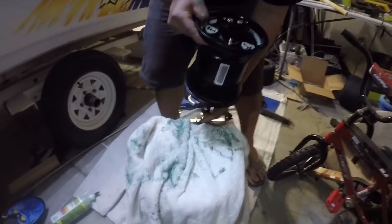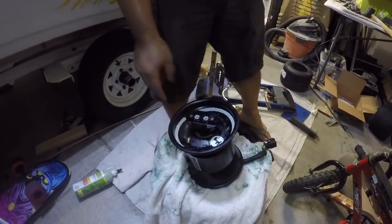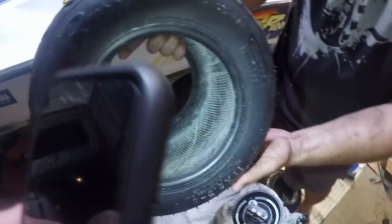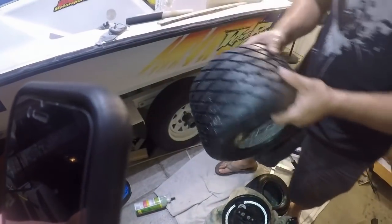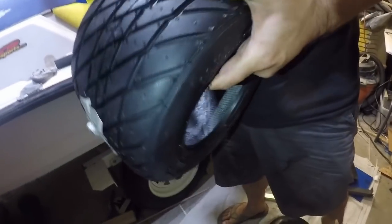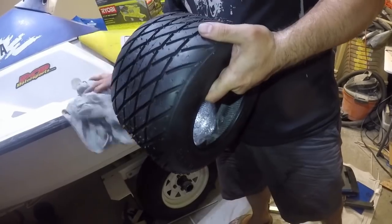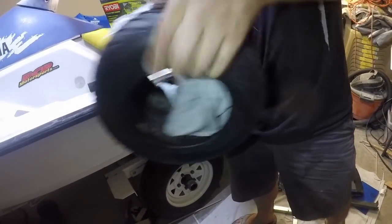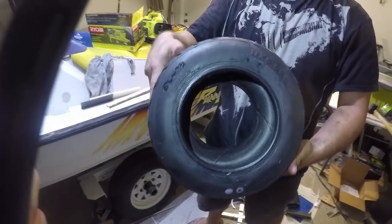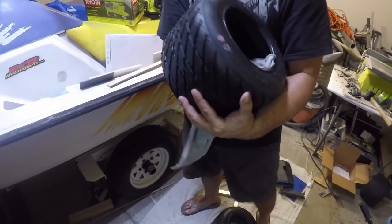You're gonna put the tire back on the same way you pulled it off — the opposite side of the cable goes through the side with the valve. Actually, let's clean the new tire real quick — these come with a white powder from the manufacturing process, so you want to clean that out first. Spray with window cleaner — people like to use Simple Green — spray it all inside and wipe it down and get rid of all that white powder. Let it dry up real quick.